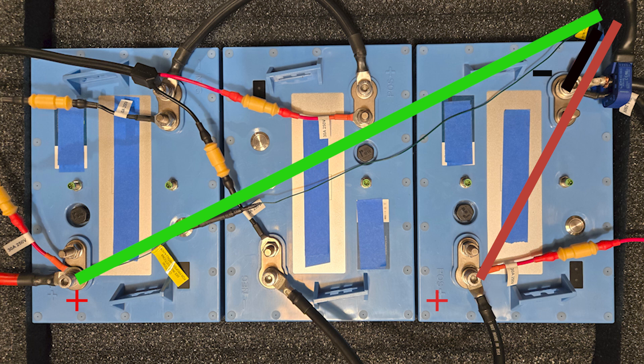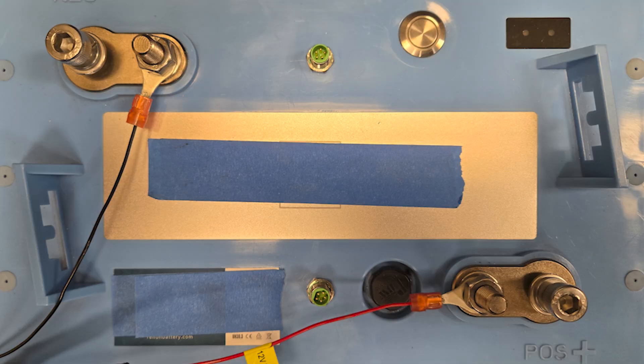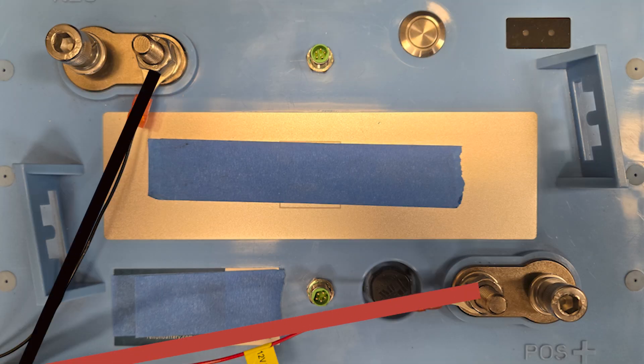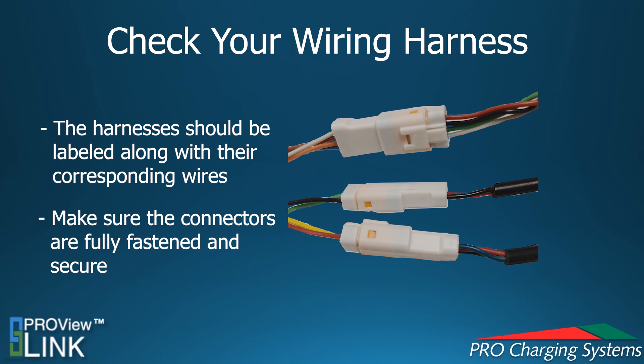Verifying that the green wire is correctly installed is crucial as it is responsible for correct voltage readings. If you have a lithium model, make sure that the blue current transducer has the arrow facing away from the battery post and has both the negative motor wire and negative charger lead running through it. The next step is to connect the starting or 12-volt side. This is a little easier as it is a simple two-wire positive and negative lead set. Lastly, check that the wiring connector clips below the gauge itself are securely fastened together.